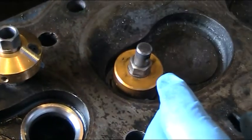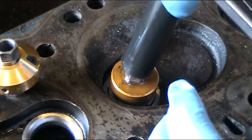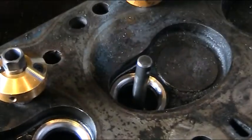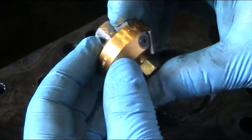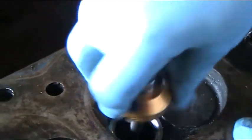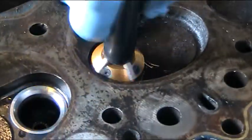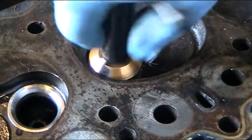It's always a noisy cut because it's a little bit chattery. You put your turning hand on, and that's your throat cut. Then we'll go in and do the 30 degree — or as Mark says, 31, always one degree out for interference. That will do this angle here slightly. Obviously they're very hard to cut being a hardened seat, and you have to do this several times.